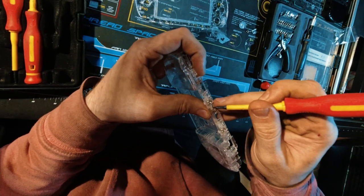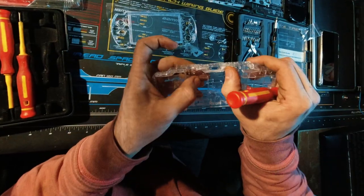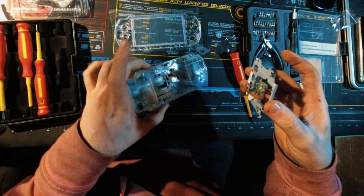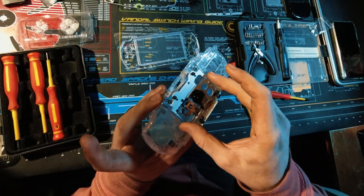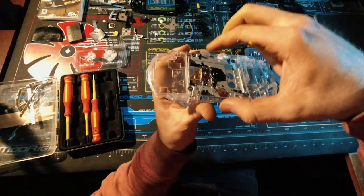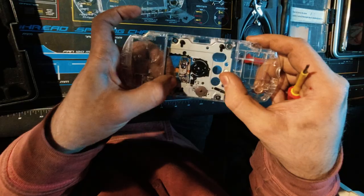Have to squish it down and onto the little white thing — so it's under that little white thing right there and it's on that little prong. So now it works. Now we can take the UMD drive, put that ribbon cable back through, put that down on the standoffs, and that ribbon cable goes through. The plus side of having a clear case is you can see where everything is getting caught.